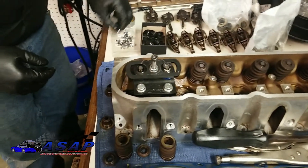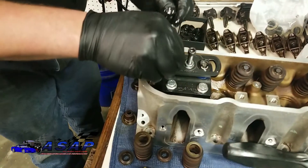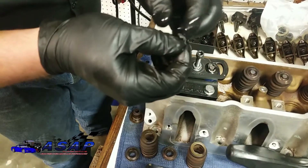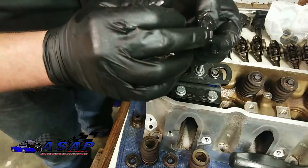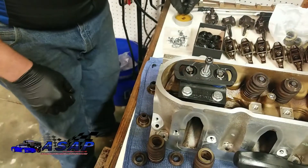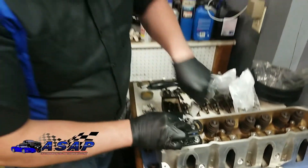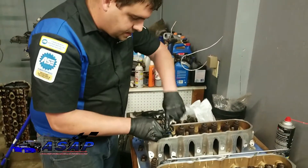Make sure you're putting the locks in the right way — they're tapered. These are 7-degree locks; we didn't go with anything crazy like 10-degree on these. They taper down and wedge in there and lock together. Sometimes these can be a little tricky, so take your time, don't get in a rush, don't try to beat the clock — just take your time.